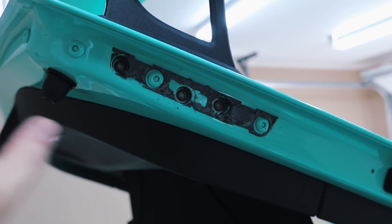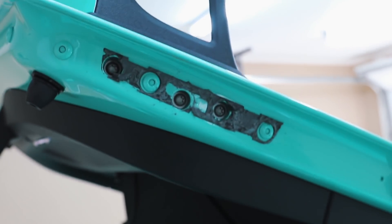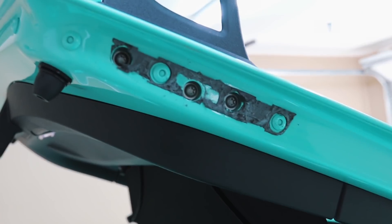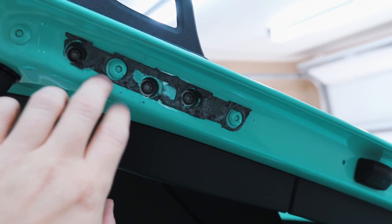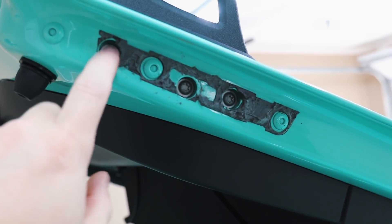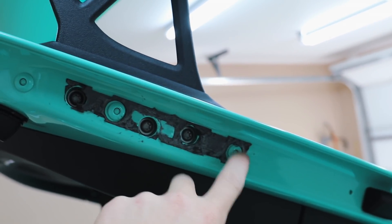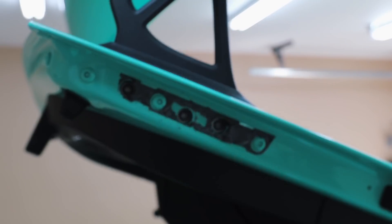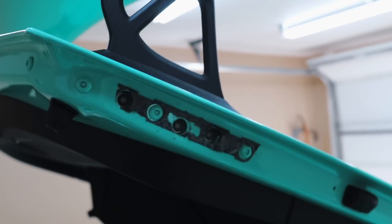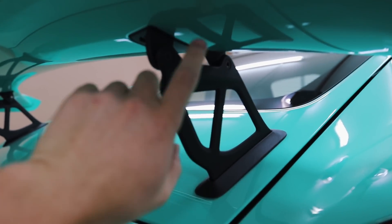Slowly run the heat gun back and forth — all you're doing is loosening this adhesive. You could clean this up or buy new pieces from Porsche, but this is pretty sticky so I'm actually going to reuse it. You don't even have to put this piece back on if you don't want to, but you have to take it off because these three bolts right here are what it mounts into. I'm going to clean up the bolts since they're visible, then get the wing unbolted so we can take the top panel off and get the supports done.